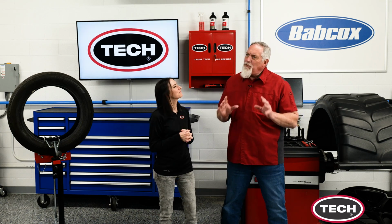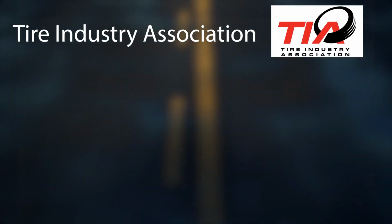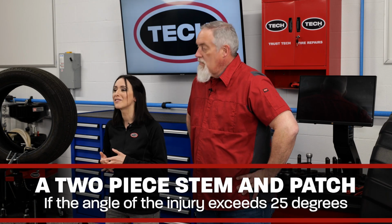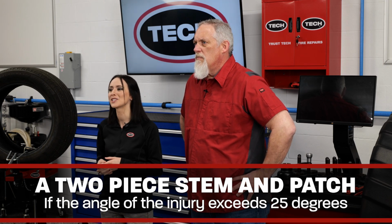So, Izzy, explain what is a safe and permanent tire repair. According to the Tire Industry Association guidelines, to properly repair a puncture in the crown area of a tire, the puncture must be filled with a cured rubber stem and patched from inside the tire with a repair patch. This type of repair can be done using a one-piece patch plug, or if the angle of the injury exceeds 25 degrees, a two-piece stem and patch repair.